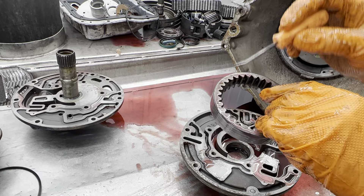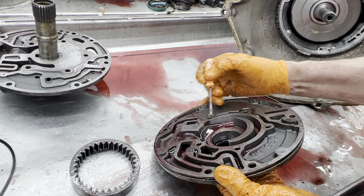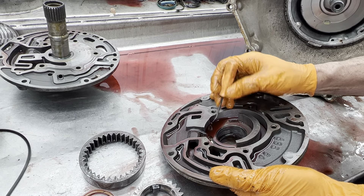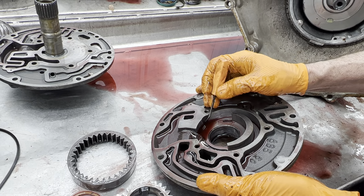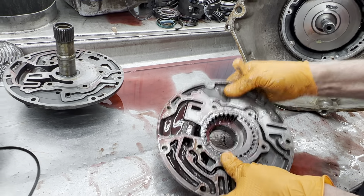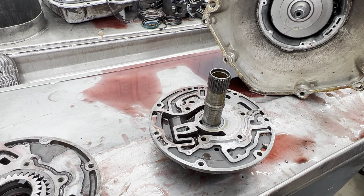You can see some bluing here, a little bit here. Let's look at the pump body — boy that's a nice looking pump body. Normally they'll wear right here through here, especially with a modulator on or shift kits with big high pressure, which will cause that issue. GM finally came in and realized if they put some line pressure oil right here and gave that gear oil on the back side it would last longer. Not all pumps come with this notch in it — if you have high horsepower or trans brake stuff you always want to find a pump that has this in it.